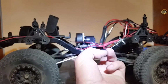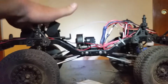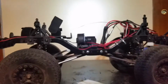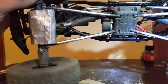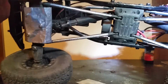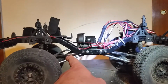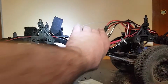Cut both of your drive shafts, and I'll demonstrate on this back one why it's so important to cut this one too. I pushed mine down, and the first time I did it, even without the bumpers on, I was starting to fight my truck to get it to go and sit down. I was like, that's not right. This thing's too long. But even in articulation, watch the drive shaft, wham, wham. That is, I don't know, what would you say? A good 1/4 inch of movement in the drive shaft that is absolutely needed. So I shaved a 1/4 inch off of this guy as well as this guy to allow for that flex to go. If this isn't shaved, you're going to go up and it's going to stop you at 3, and you're going to go, oh, there's only 3 inches here. Cut your back drive shaft.